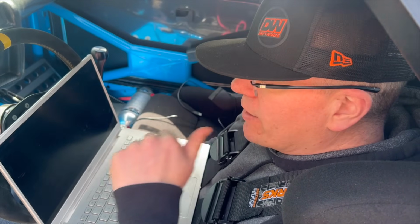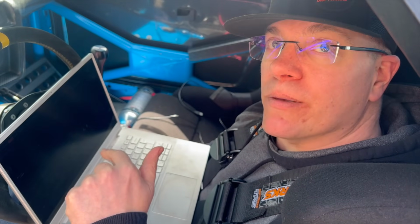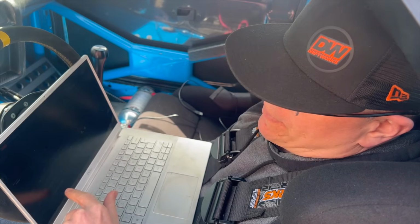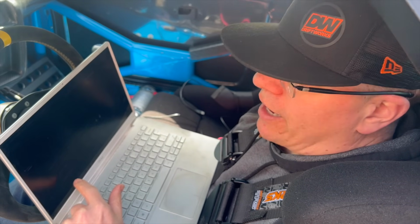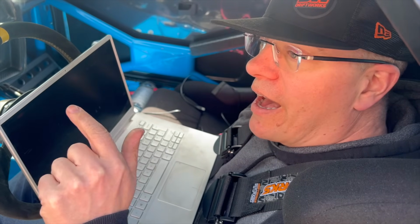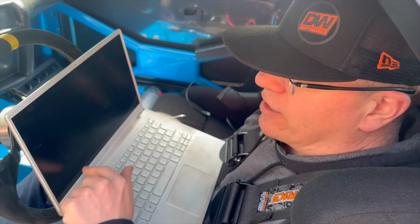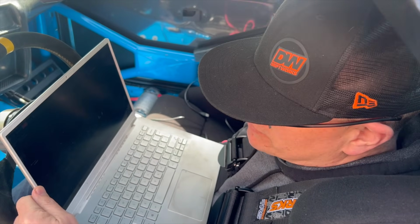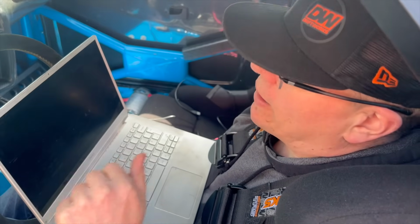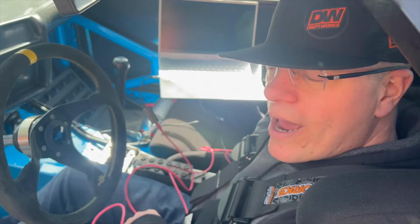10 now. And we have put a BMW cam sensor back in it, a brand new cam position sensor. So I'm just going to keep an eye on whether this shows closed loop currently for the Vanos system, and if it breaks because of the cam sensor for any reason, Jay reckons it goes to disabled. It goes to open loop. Open loop, not disabled? No, open loop. Open loop is what I'm looking for, so I'm going to give it another rip now, but yeah, feels strange, definitely.